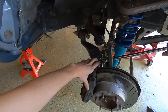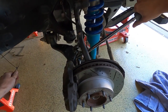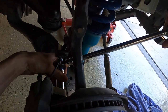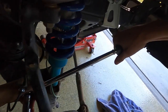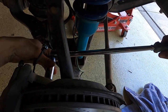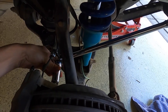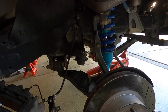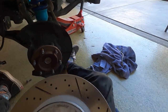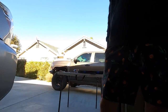Now that we got the extended brake line in, we can pull the caliper off and get it to the side. I have zip ties set up, ready to grab it so I'm not trying to juggle it while stringing it up. All we have to do is there's just two 17-millimeter bolts on the back side and it's completely free. One of my favorite installs was doing my rotors and brake pads — so easy, so fast. Drilled and slotted R1 Concepts — little plug for my other video.